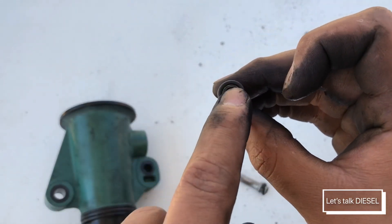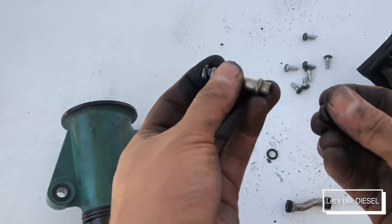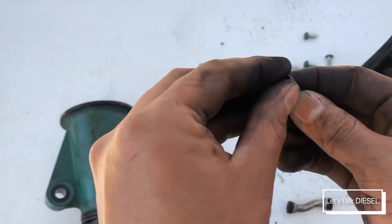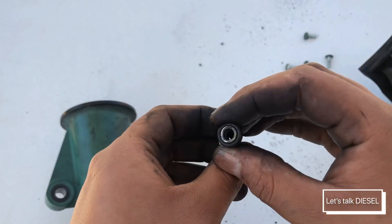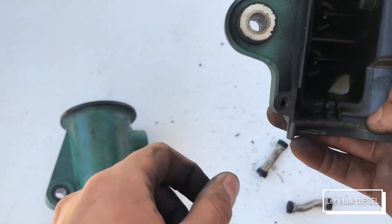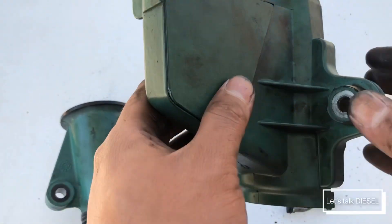Make sure these tubes are really nice and clean — they're not that hard to clean. Use hot water to clean them, and if you have a blower gun, use it — it's gonna help a lot. Check this part and make sure there are no cracks around here or in this area. Obviously if you can see damage from outside, just throw this part away because it's not good anymore.